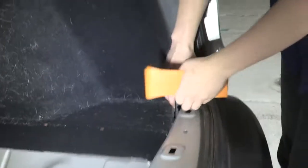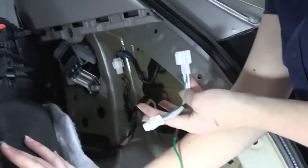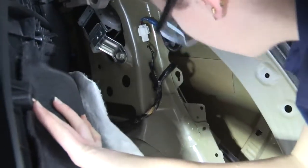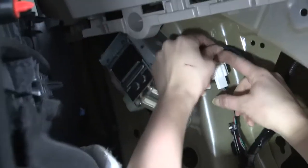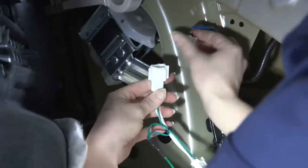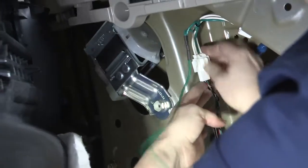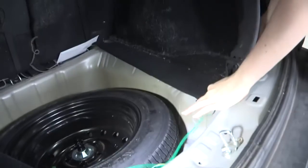We're now ready to remove our passenger side interior panel. It's going to be the same as we did on the driver's side — we're going to use our interior trim removal tool. Tuck it between this door panel and the weather stripping. You can separate these two panels and just fold this out of the way. Here's our green wire that's attached to our circuit. We've got our connectors here, and we're going to plug them into this connector — it disconnects just like the one on the driver's side. So we'll just push in that tab, lift that connector up, and now it's ready to be plugged into our harness. Everything's clicked into place. This wire is going to be behind our interior side panel here and between this lower panel that we removed earlier. We'll come back to get that tucked in.